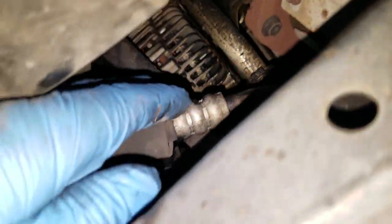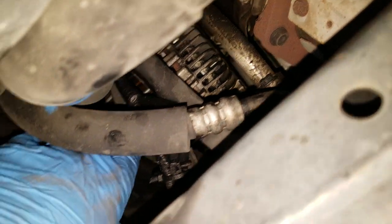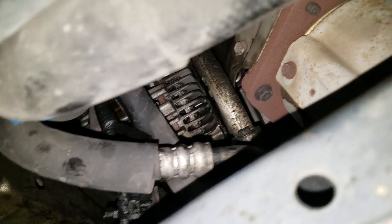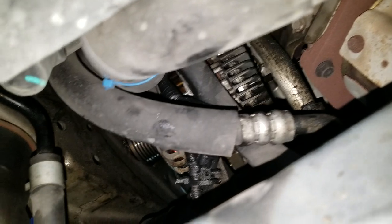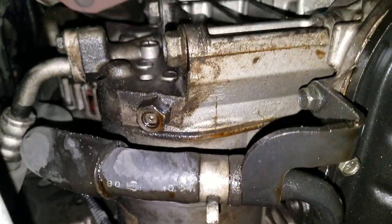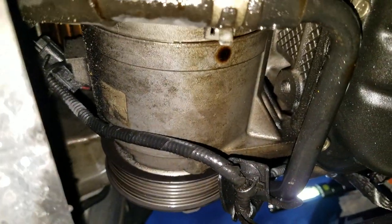And then once we get that cleared out, you can see that that alternator is right there above it. This is it, my fingers are on it, and we'll get the bolts out of it. Just make sure that when you get to this point, you take the battery loose and disconnect all battery power, because if you touch that to the ground anywhere and spark it, you might be replacing your computer and no telling what else if you go fooling around with the fireworks. So let's not do that. Let's keep it simple.